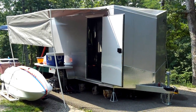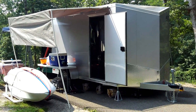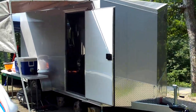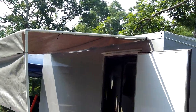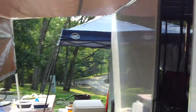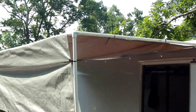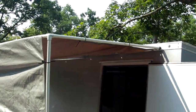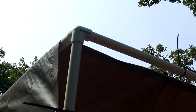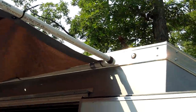This is a view of our six by twelve camper — an enclosed trailer camper conversion. We watched a lot of YouTube videos on what to do. This is an aluminum six by twelve. This awning right here we built out of three-quarter inch PVC, with a tarp zip tied on top. We used different tees and elbows to make it work.